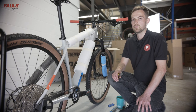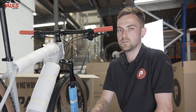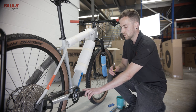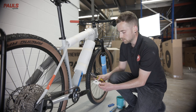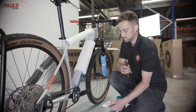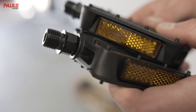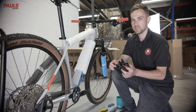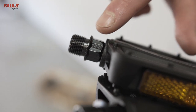The next step will be to install your pedals. Not all bikes come with pedals, but if yours does, you'll find these in the box of user manuals. Remove any packaging from the crank arms and carefully cut the card off. This card explains how to install your pedals correctly. Grab both pedals — these are left and right specific, so be very careful to check which is which. They'll either have an L and an R stamped on the axle, or the left hand pedal will have serrated marks.